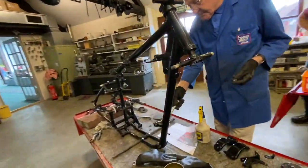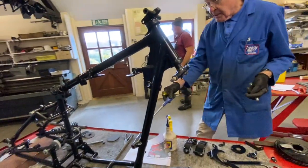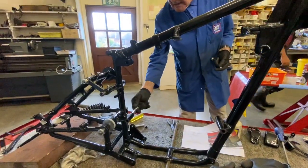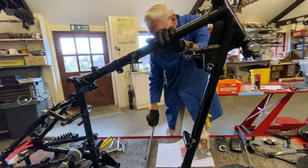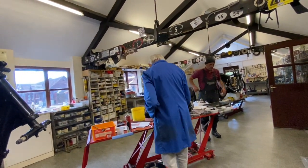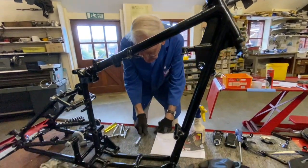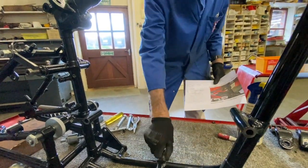A true sign of an amateur is if you get bolts sticking right through like that. So we'll have these two in line in case it won't fit easy — I can pop those through while I get sorted out. Just check the length. Right, so what we're going to do now is set the engine in. The most critical bit we've got to watch is this bottom bit here, where I've got to get the bottom engine plates over the top and get that footrest job through — it's a tricky situation.